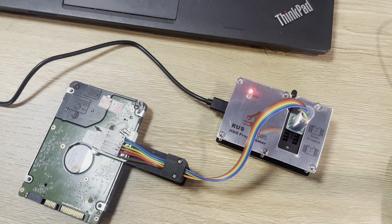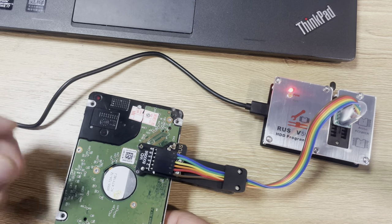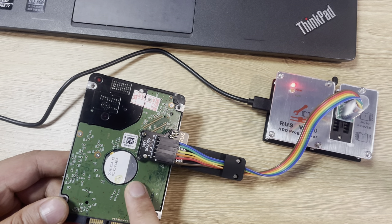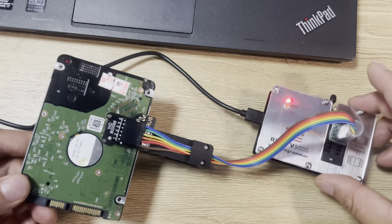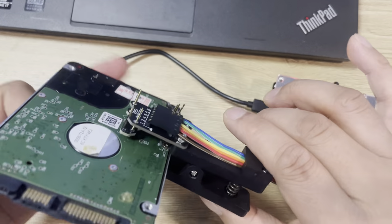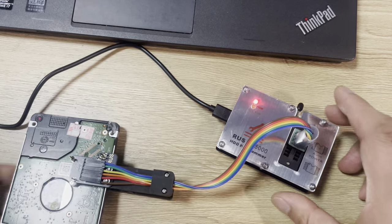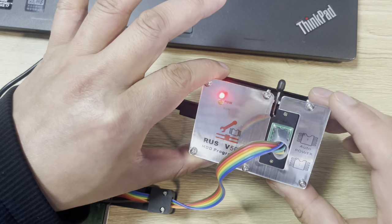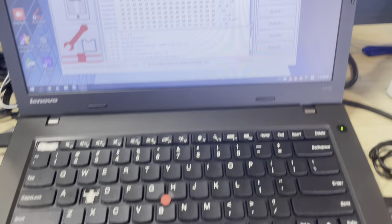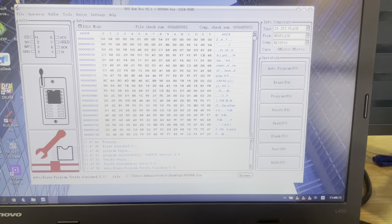In many cases, when the drive has MCU lock or some special encryption on the hard drive PCB, users cannot use firmware repair tools to read and write the ROM. So users can use this method — simply install this clip adapter to the hard drive PCB, then use the chip-on-flash programmer connected to the computer via USB cable, and use the software to read and write the ROM easily. Thank you for watching the video.